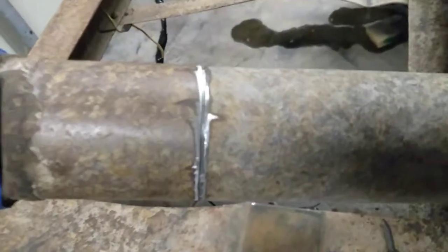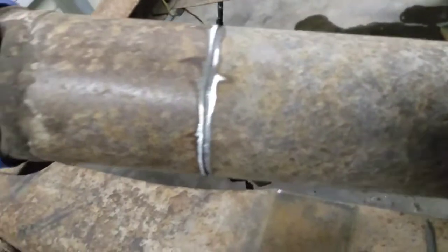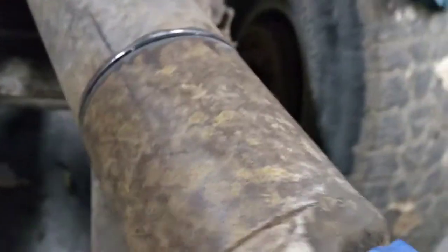Alright, so I've got them put together there. Got my hose clamp shrinker off of there and shoved them in to where I've got, oh, there's not quite 1/8 of an inch of gap there, and that's what I want so I can get down in there and weld to that sleeve really good. So I've got that done. That's going to do most of the alignment work on it here.